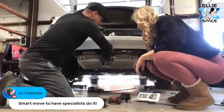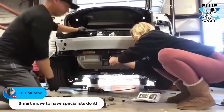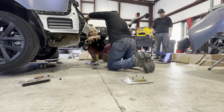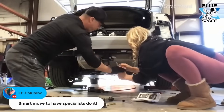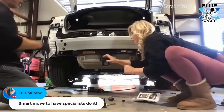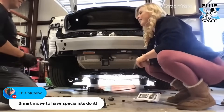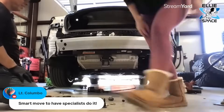Just a simple crescent wrench — pick one up from Harbor Freight for a couple bucks. Can I try one? Just one! How tight do you want it? You want it tight where it locks the lock washer. See how it's flat already? Just give it a little more snug and that's it. You don't want to over-tighten it because when you go to take it off it's going to be hard. It's solid though — she did it!